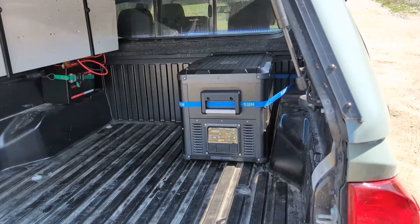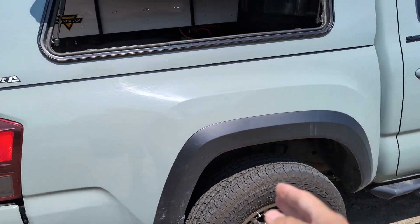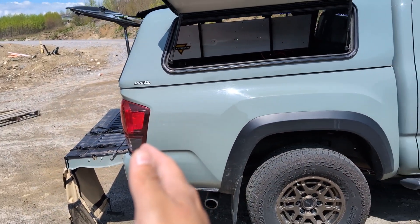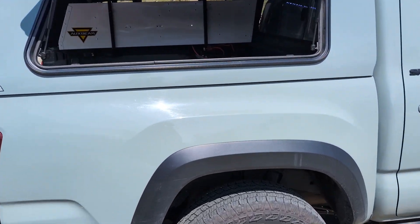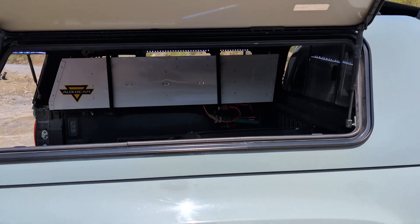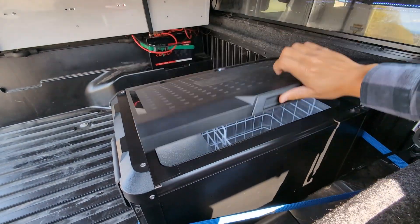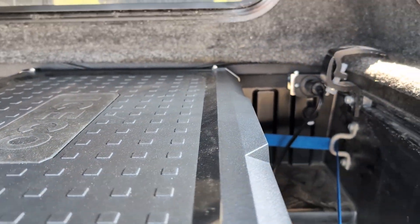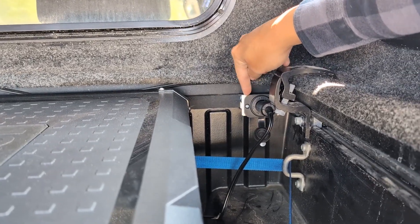I do have the fridge in an uncommon area — the reason I want it over the wheels is to have that weight over the axle rather than behind the truck behind the axle, which is a bad spot for weight distribution. Having the truck cap with side doors allows me full access to the fridge from the side. This fridge is running off the dedicated outlet I installed right here. I can also run a diesel heater or other accessories off this outlet. Iceco reached out and wanted me to try their fridge — they also gave me a discount link, which is in the description.